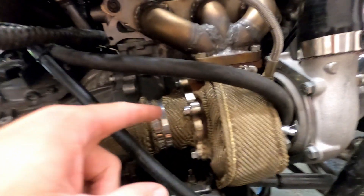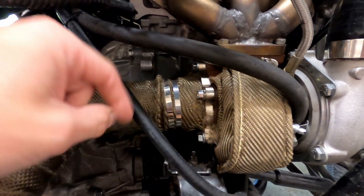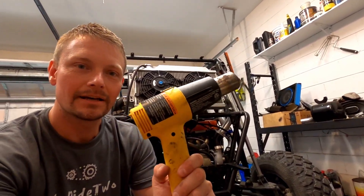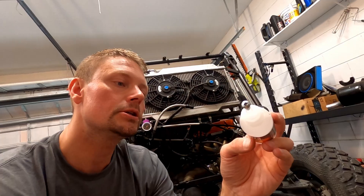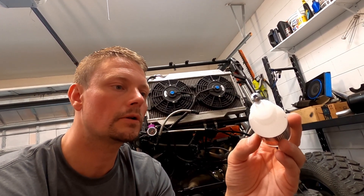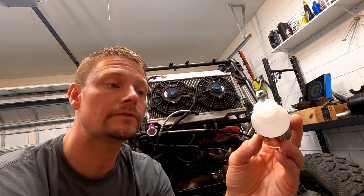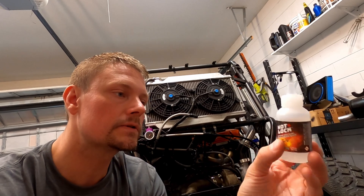I'm all done with the tough part. That took me about 45 minutes just to run all of the bolts underneath there into the housing. I almost forgot to cover the most important part of the application — the heat applied after you get your bolts into place. I'm going to read you the instructions: for quarter inch diameter fasteners, which is what we're close to, apply 250 degrees Fahrenheit for four minutes. So with mine being eight millimeter bolts, I'm probably going to want to apply 250 degrees Fahrenheit for five to six minutes.